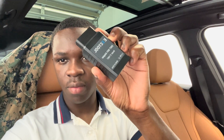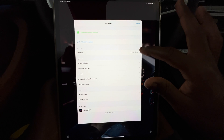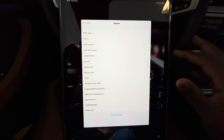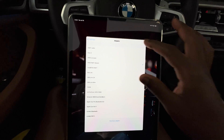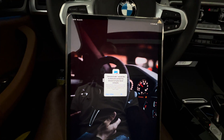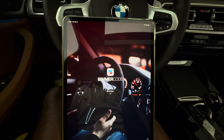Shout out to them for sending me this to share with you guys — this video is sponsored by them today. The device has an ethernet port at the bottom as well as your OBD connection. Once you're in the Bimmer Code app, just go to Settings, click on Adapter, and change that to MHD ENET Black. Once you do that, go back and hit Connect — it should connect once your device is connected to the wi-fi.